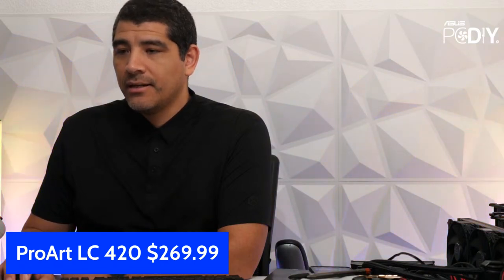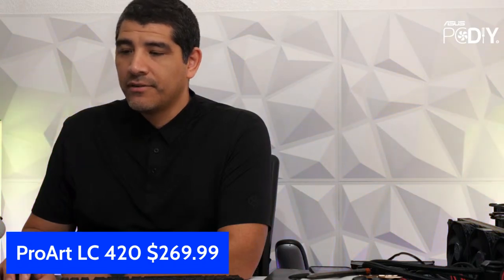So we have not previously offered. We've pretty much had a 120, we've had 240, we've had 280, and we now have 360s, of course, but we haven't done a 420. So this will be our first 420 millimeter based product. Now, it's important to note that 420s do present a little bit more of a challenge in terms of relative interoperability and compatibility. That's because not many chassis actually support this. That's the reason why initially we didn't decide to release a product that offered a 420 millimeter base radiator configuration. But now we are happy to finally be able to offer this.